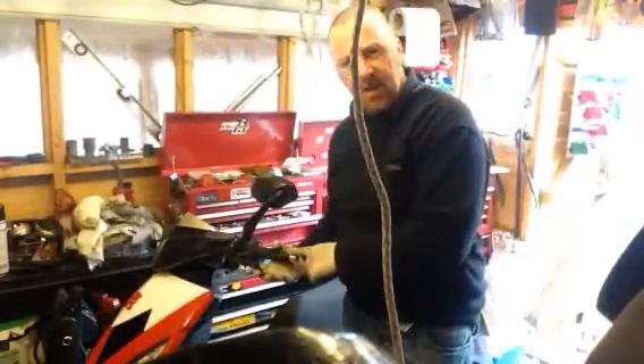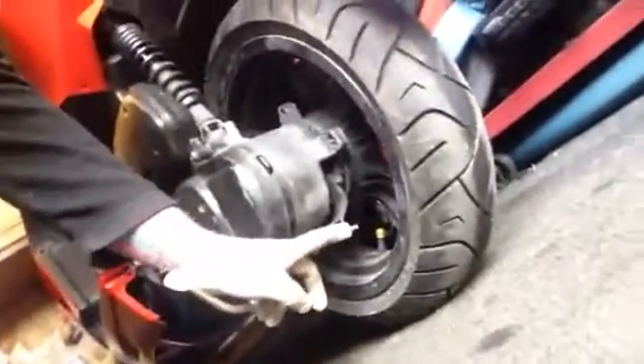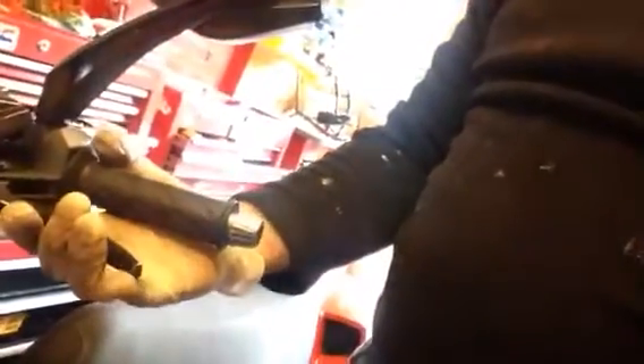Remember the 50cc's? The ordinary ones have a cable back brake, and this again was sticky. Let me show you that - here it is, the connection bit here. And all it was was sticky. So if I do this, I can see it moving. WD-40, good old WD-40, give it a clean with WD-40. The end is off here as well - it can be an MOT failure. I've got a load in here so I'll be able to swap that over.